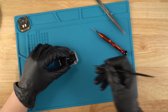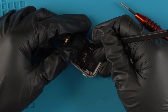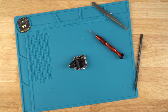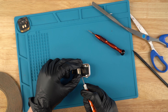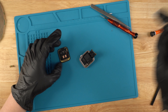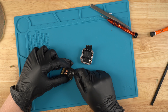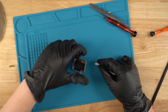The last thing you've got to do is connect the battery, which we'll just use the spudger for. Once you have the battery connected, I'm just going to put some double-sided tape on here — if you have some at home you can grab some, or any kind of double-sided tape will work. I usually go with two pieces. Once you put the two pieces of double-sided tape on, you just put the battery back on just like that. A little bit of alcohol — I'm just going to take off the residue, the old residue from the previous glue that was on here before, just so the screen is not sticking up. Once we've cleaned the screen, we'll just clean the actual housing.